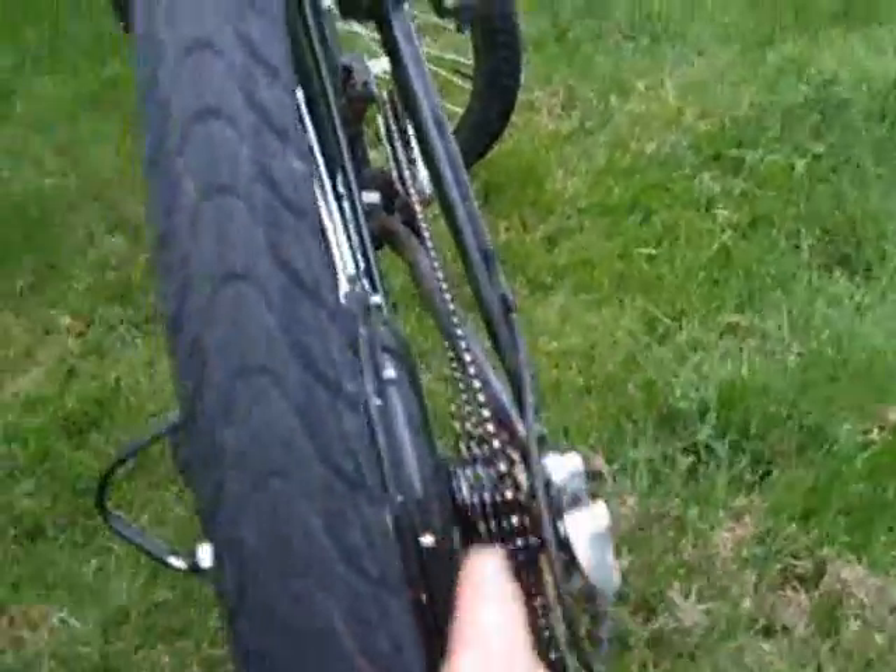Now there's a few ways to get around it. This frame's kind of flexible, so it's not a problem to stretch it out. Add spacers on the left-hand side, which takes your frame on the left further away, centering your hub little by little.